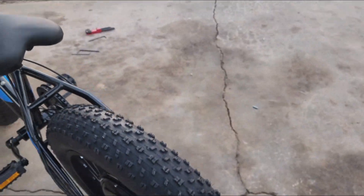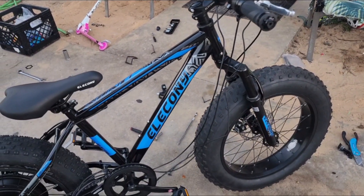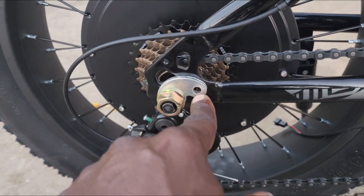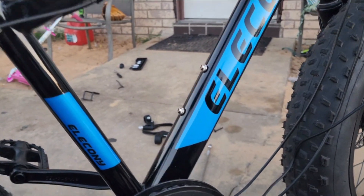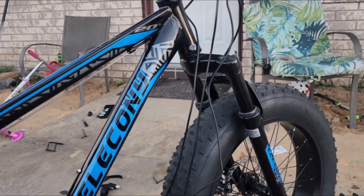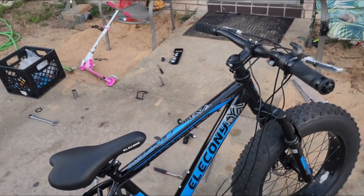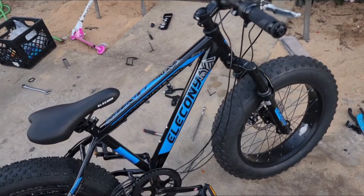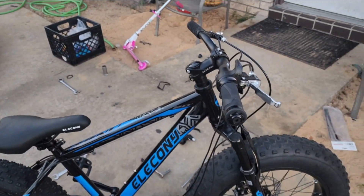It's going to be a nice ride for him. I've got the tires on with a little bit of cushion right now. We're going to be drilling through here to bolt it up tight on both sides. Tomorrow we're going to be making the batteries — gluing them together and doing either nickel strips with copper over it or just plain copper. The controller is going to go in the middle, the battery on the bottom tube, and I'll probably weld something up to give the battery something to rest on with some cushion so it doesn't slide down. I'll have some velcro to strap it in.